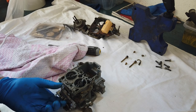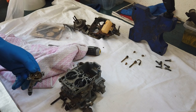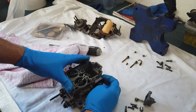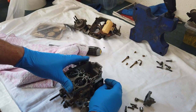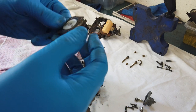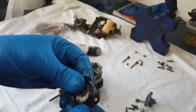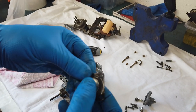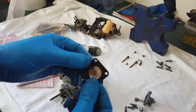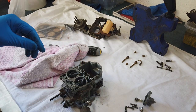This, I believe, is the choke mechanism, which richens the mixture. And then there is the diaphragm that pumps fuel in when you need to accelerate. This is one of those things that very often gets hard or brittle and doesn't pump very well — and this is the case on this one. It's completely hard right here. It's not pumping efficiently, so it will be a very good thing to change it. This will make the acceleration response a lot smoother and better.